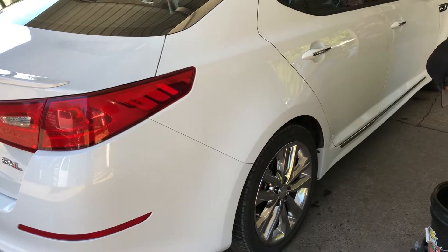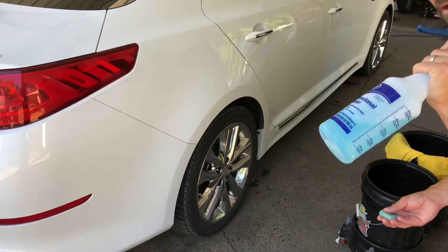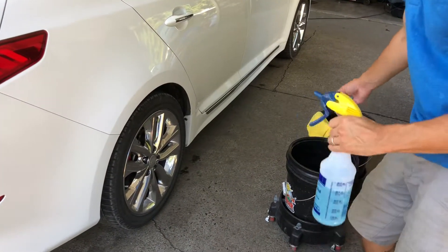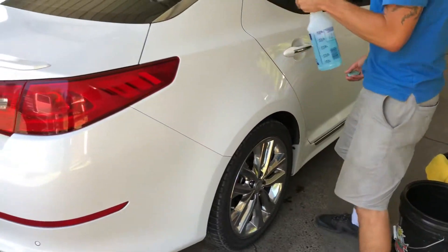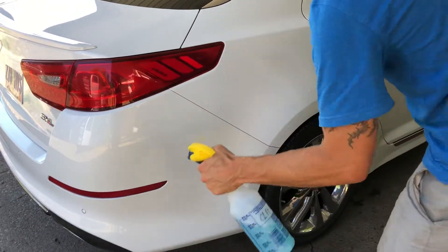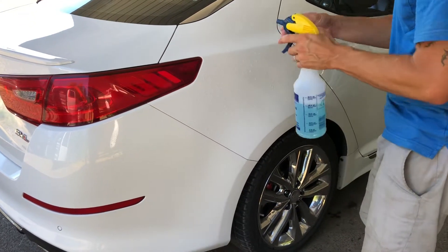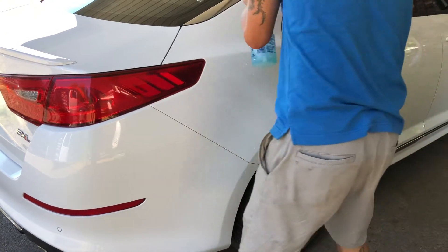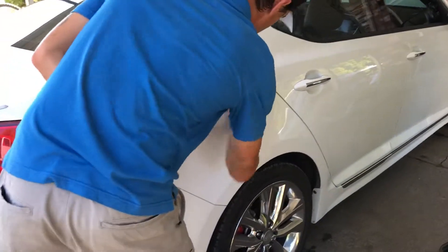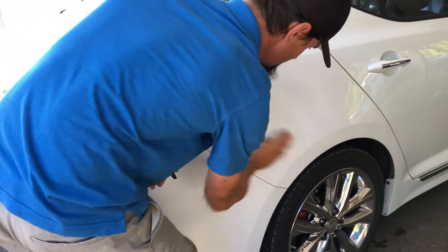I'm going to now stick that back in the bucket. I got my clay bar. I got some more diluted — this is about probably 10 to 1 in the bucket. I got an ounce for two gallons in there. So I'm going to now spray this panel down pretty heavily. As you can tell, I didn't dry it. That's one of the things that's a little bit different — this is a little bit quicker because I'm not taking that extra step on a cleaner vehicle. That's very important. Now I'm going to go in there very, very lightly with my clay bar. I'm basically just skimming the surface just to take off any sort of bonded contaminants that might be on that surface still.